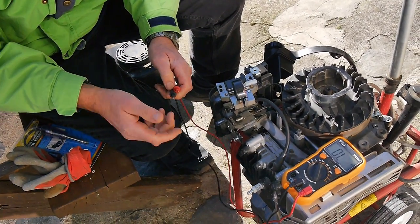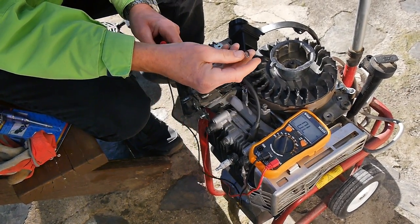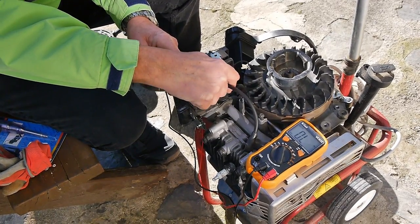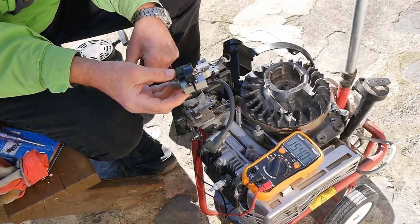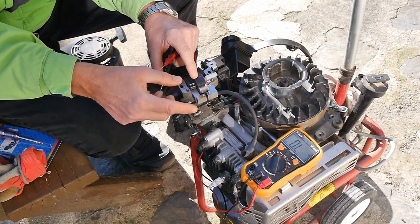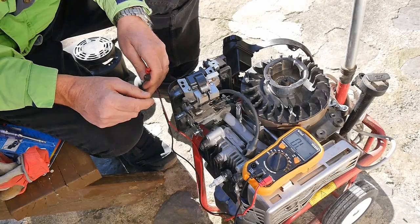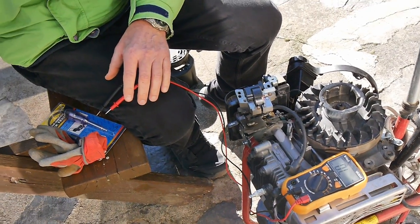Now this engine is a simple thing. It can only be the spark plug, or the kill wire here is earthed on something — this here is touching a piece of metal. So what could it be? It can only be this ignition module that's wrong with it. There is nothing else that's wrong. So I thought I would buy another one, a new one.